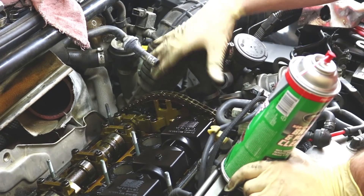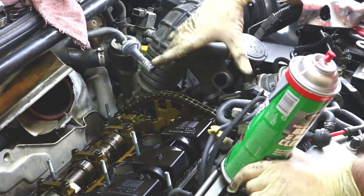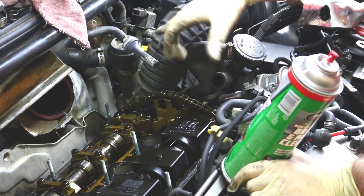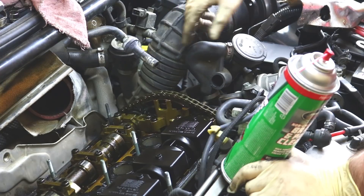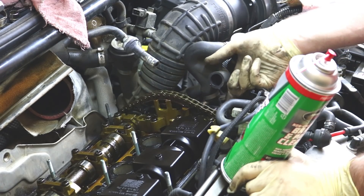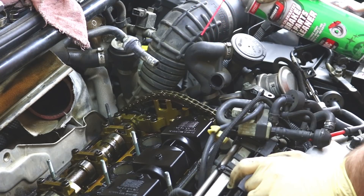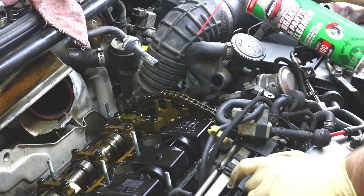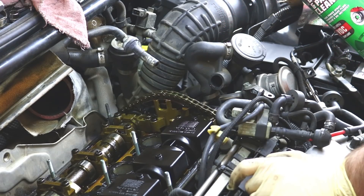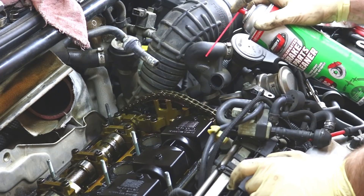Now we're going to talk about the chain tensioner seal. This is the timing chain that ties the camshafts together. On later model cars that have variable valve timing you would have an electrical plug with a solenoid attached, but this car doesn't have that — you still have the mounting for it and there's a gasket here. It's leaking all down this side of the engine. It uses a flat metal gasket as well as a half moon underneath of it, and that's what's generally going to be leaking. So we've got brake clean here — we're going to get this thing cleaned up. Whenever you do fix oil leaks, you want to make sure that you clean it up thoroughly so that when you go back after doing the install, you know for sure whether your leak is completely resolved or not.